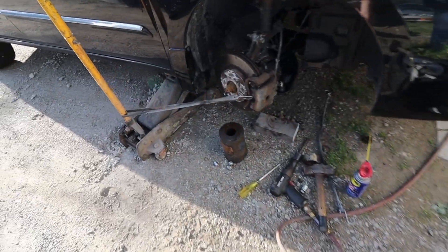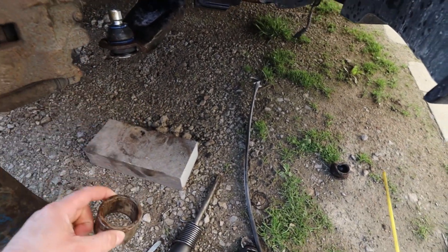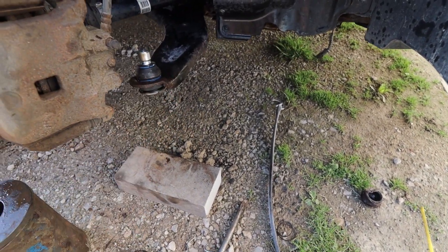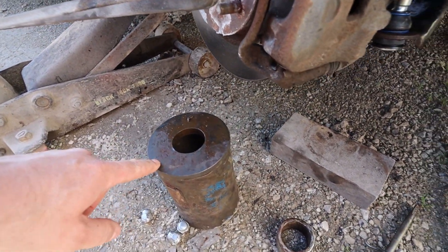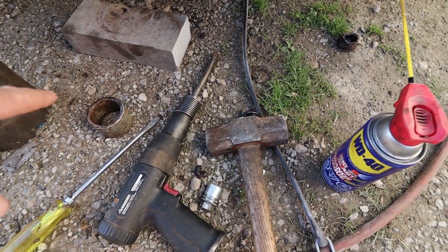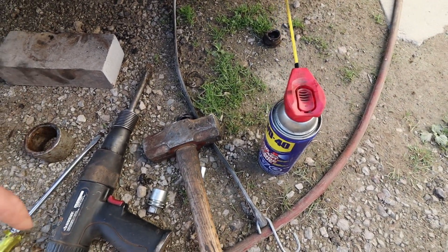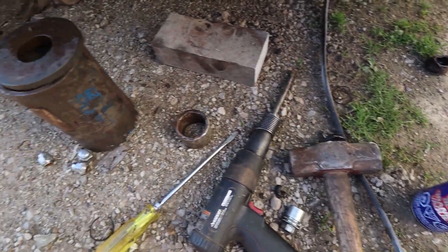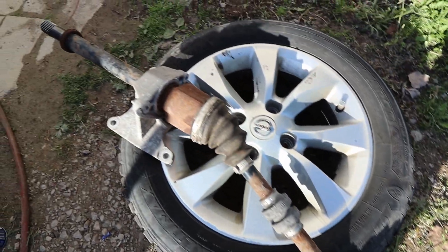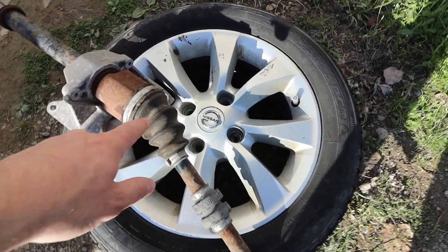So far, old man used a piece of pipe that fits around right here so when you hammer on the ball joint you can actually drop it. It's just a metal piece — two of them. You can use an air chisel, a hammer and regular chisel, WD-40, and a screwdriver. That's about it.